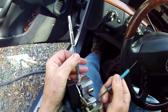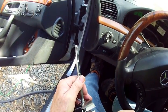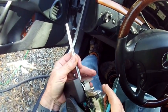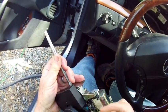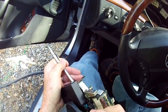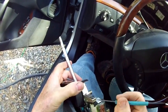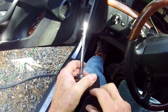So that's the theory of operation for getting it out of park. What had happened to this particular mechanism: the people beating on the shifter trying to get it to shift had mushroomed out the plate where it wants to line up on the stop mechanism. This plate right here was all mushroomed out - so it was now a rounded edge. Putting it on the stop, it had a nice round edge to it and it would just keep shifting. That was the particular issue with this car.